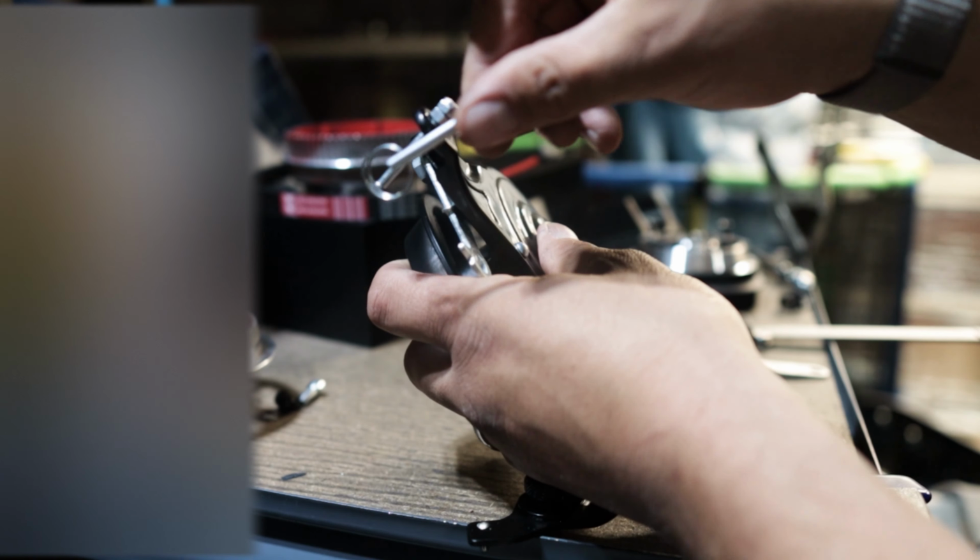This is a Charged Up 3D mount, and there's no hole to send the harness straight up to the forks. So I went ahead and I drilled a hole. This is a stepper bit from Harbor Freight, and you drill a hole in the corner there, and then you can drill out the hole in your fork, and you can send that harness straight up just like the original motor, and it goes right to your controller with no extensions, nothing like that, and it's super clean.